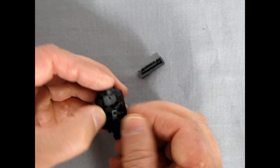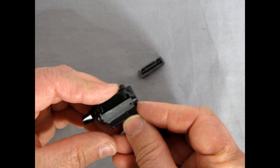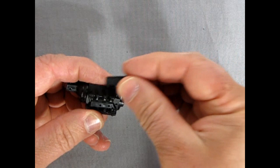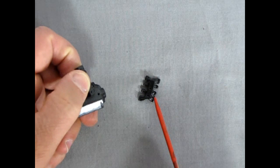The two little holes go toward the front for lining up with the hole for our magneto. If you put the bump at the back, it prevents the intake manifold from lining up to that point. If you flip it around to the front, then the manifold stops on the second inlet — so that's where we want it. I'm going to paint this engine black, but I'll paint the intake manifold aluminum so it matches the Mercury motor.